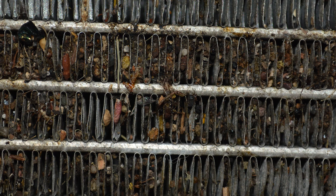This is why preventative maintenance is by far the best thing you can do — get an aftermarket grill. The Alpine should have come with some sort of mesh grill on it. There are huge amounts of crud you cannot get to easily; you need to disassemble the front of your car. It's about half to two-thirds of a day job to remove the entire front, get access to the radiators, soak them, wash them, scrub and clean them, then reassemble — and then do it all over again depending on how much driving you do. That is exactly why you need to get the grill.